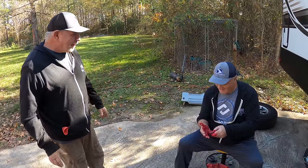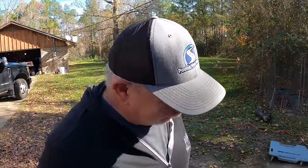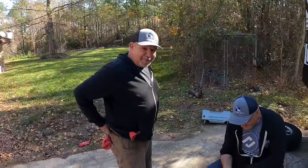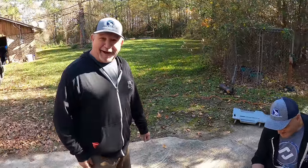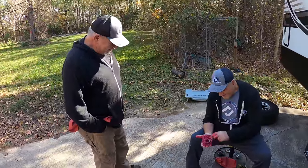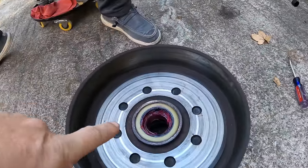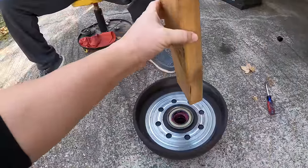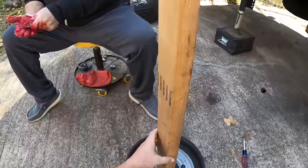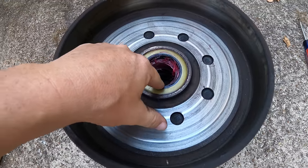I'm not gonna let you have all the fun. Phil, you know the only bad part about making this video? What? Now Lolo is gonna know that you know how to do it. All right, so we have our new seal in. To put that in, you just take a dead blow hammer, get it started, and when you're close you take a flat 2x4, put it right there, and give it a few love taps. Make sure when you put it in it's nice and flush so you don't mess up the seal.